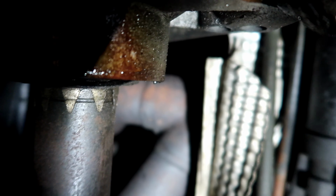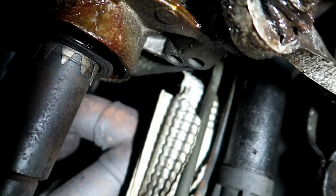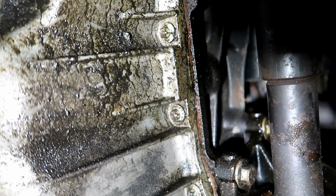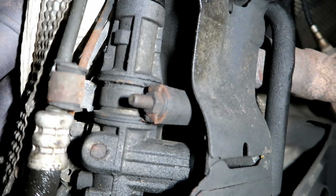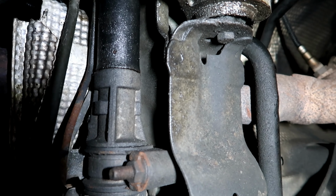Right, underneath the car, there's a lot of oil here, to be honest. If you can see, let me spin you around so you're looking at the same thing as me. I think the seal that sits there, I'm assuming there'll be a seal in there, gearbox end seal, something like that, I think is a culprit, because if you look on here everything's covered, and obviously this bit's covered, back of the sump. I don't think it's engine oil. The CV joint's sort of parted ways with us now. And I'm also looking at that, I think it's a dog bone mount, I think that's what you call them. I know they're meant to have play. To me there's a lot of play there, so might look at the polybush alternative.